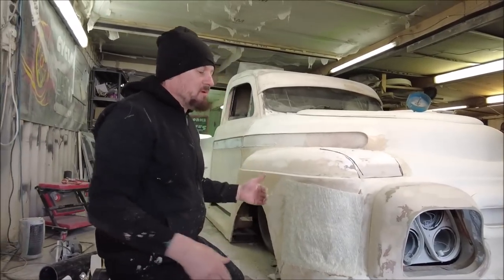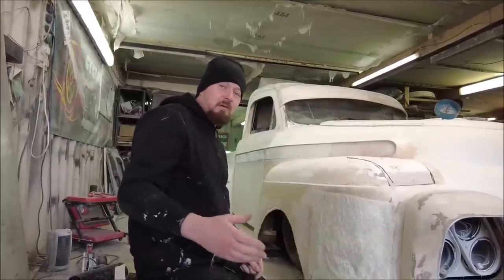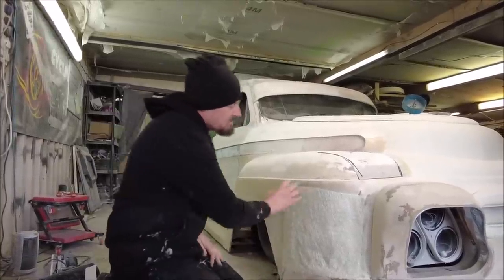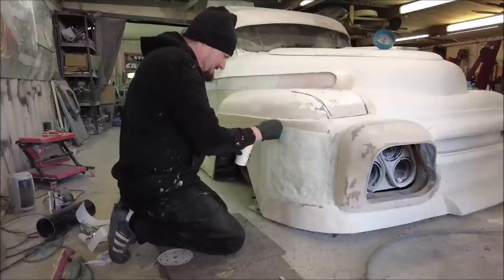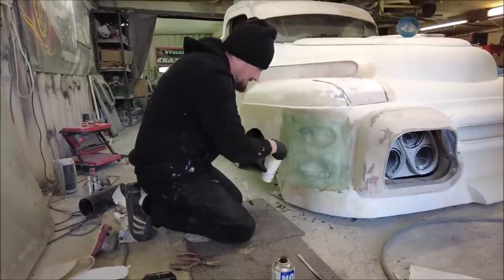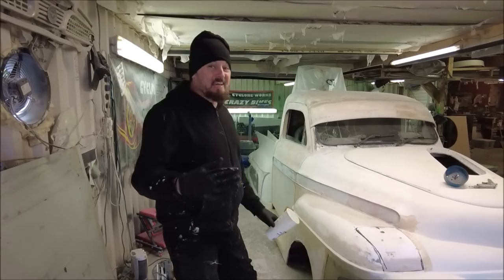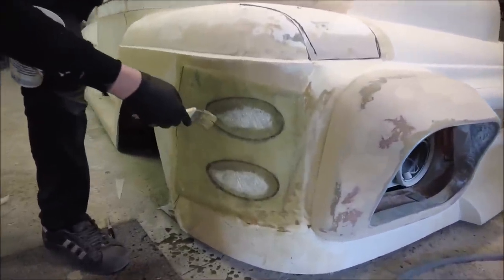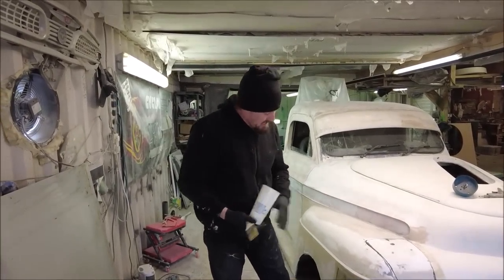I'm going on with three layers of mat. I don't want to put three layers on with the glue because two is all you're ever going to get the resin to soak through when gluing them on, so now I'll soak this out in resin and then pop the third one over and that will just stick to the resin. That's it - three layers all well soaked and they've adhered well. Around here I can see this dark line which tells me it's adhered nicely to the form. Leave that overnight and we'll come back and smooth it out.